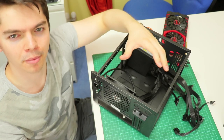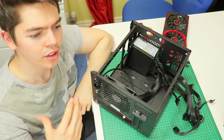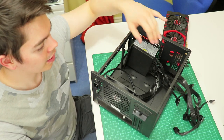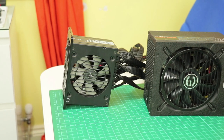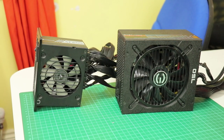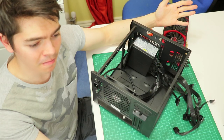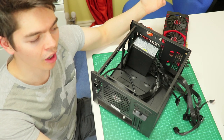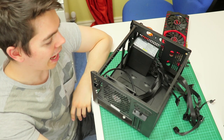That is the form factor of the power supply unit. This is designed for basically mini ITX cases, really compact cases. This is a Corsair SF600. It's only 100 millimeters deep, and it is way thinner and smaller in terms of its height as well than a standard ATX power supply unit. It packs 600 watts of power. Pretty much most systems with a single graphics card, even potentially up to Threadripper, you could run on this power supply unit and you wouldn't have a problem.